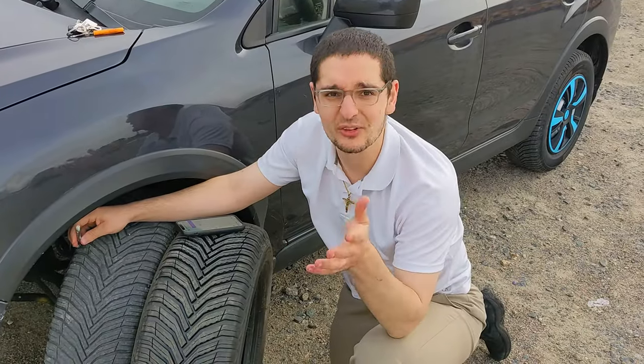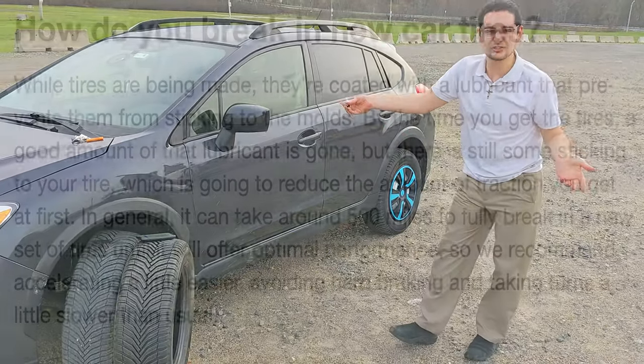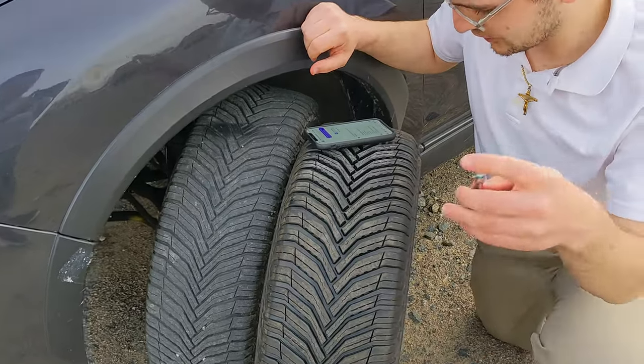I rotate every 5,000 miles at my oil change. Keep in mind this is a 3,200-pound vehicle, because I'm going to be replacing these around 4/32nds. A lot of people have the hype that Michelin keeps the compound with that variable temperature adaptation the same all the way through, so these keep their snow performance much better. Yes, that is true, but let's look closely.